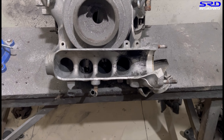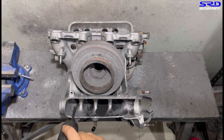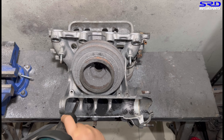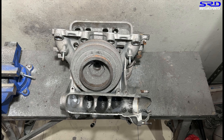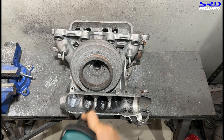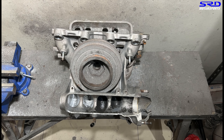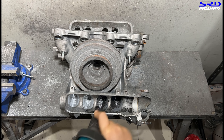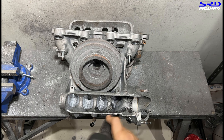We use the pulley just to put it on top so that it won't move around — you don't want the manifold falling off when you're porting it. To start, we go with the carbide here. You can start with an abrasive, but it's going to take too long, so we go with the carbide first, and with time lapse it doesn't get too boring. As you can see, we're starting to take the initial shaping. When you're doing this, you can actually feel the ridges or the misalignment of the casting, so it's easy to smooth it out and fix it. By doing that, it improves the efficiency of the intake manifold because air flows better when everything is consistent and contoured well.